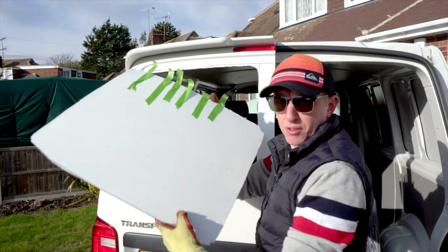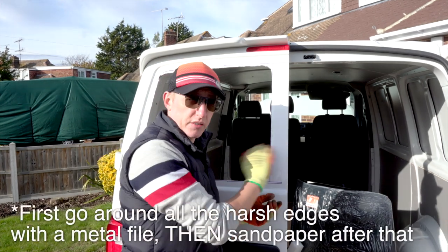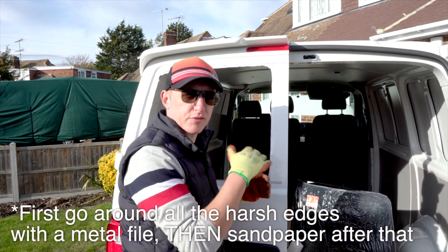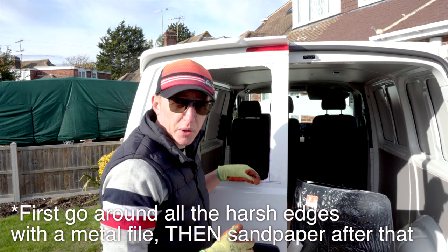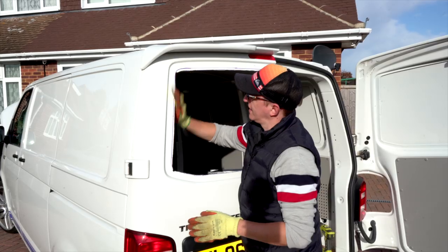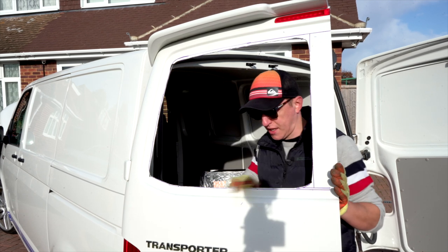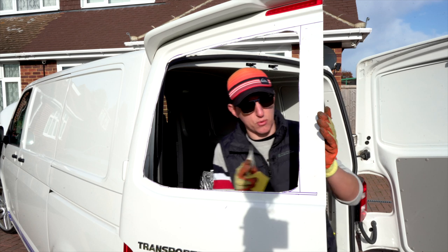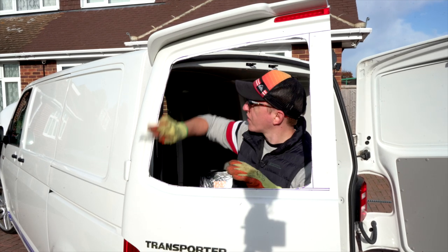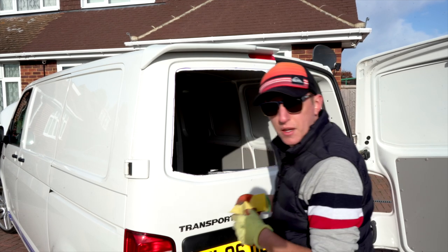Very slowly take those off and that piece goes to scrap. There's a bit of a rough edge around here, so I'm going to get the sandpaper and give it a really good buff down to get those edges off. I'll go with the coarser grit first and then finer and finer — starting with 60, then 120, then 180 — just to sand that down and get rid of the harsh burrs of metal.